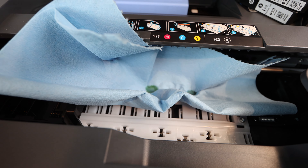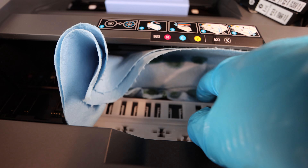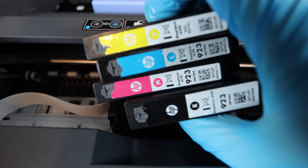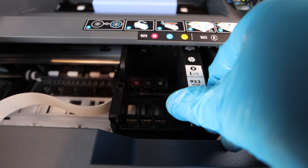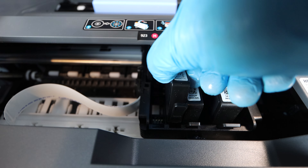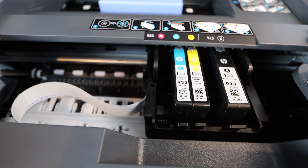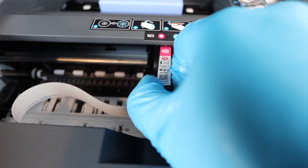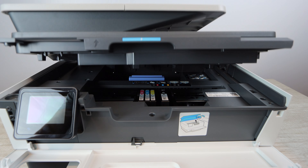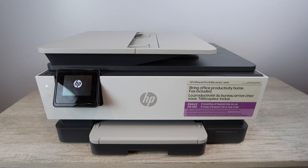Now we're going to remove the paper towel and dry up any excess that may have dripped outside or under it. This is where you'll want to replace your ink — preferably buy some new ink; there will be a link in the description below. If you know for a fact your ink is totally full and functional, go ahead and use your old ink. But if not, please make sure to swap out at least the colors that had an issue. Swap those colors for new ink cartridges — it's a very important part of this process.